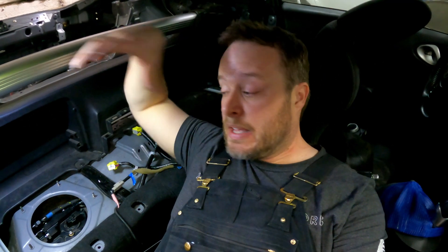There is going to be a stud included with this — put that in the front of the assembly if possible. Have your fuel drained out of your tank because you have to reach down in there and put the hanger assembly on while it's inside the tank. The canister is incredibly tight going in, and there are a couple of metal plates that have to go on while it's in the tank. First, test your twin assembly inside the canister before you put it in the tank. There are mesh fuel socks — make sure those are adjusted correctly and everything fits before inserting the assembly.